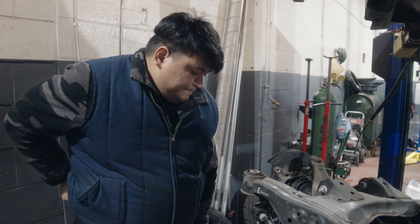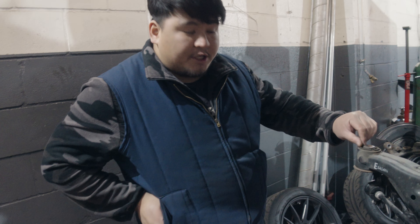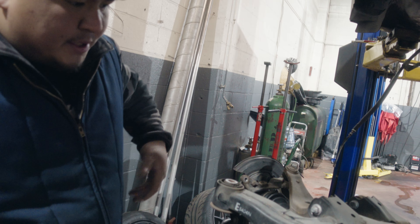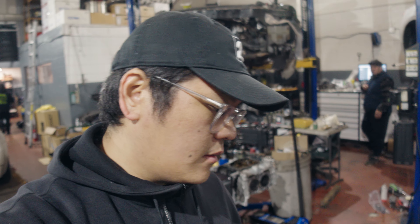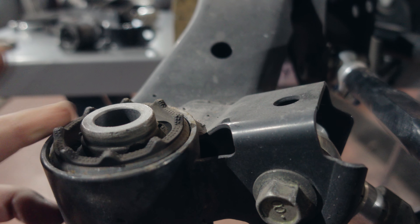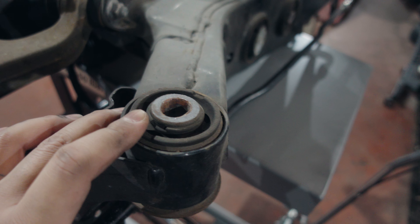So, do we want to burn or do we press? It's definitely more time consuming if you were to press it out. Whereas if you burn it, you just burn it — it falls out and then you just take out the air hammer or air chisel and chisel it in and it just comes out. It's pretty simple — most efficient. Burning is just a little messy, that's the only thing. So it's got pros and cons. I think what we're going to do to make this as efficient as possible is bust out the torch and burn the rubber bushings out. That's a fairly painless way of doing this instead of trying to press it out. In terms of the bushings, you can see there are four here. The ones on the front — you see the OEM ones are basically dimpled to give a little more tolerance when the washer is on top, just giving it a more plush ride. And then we have the rear ones right here as well. So let's be pyromaniacs and light it up.